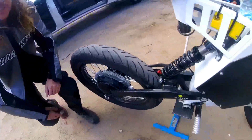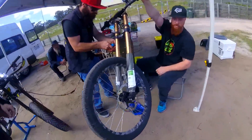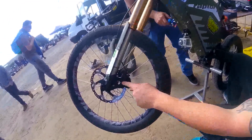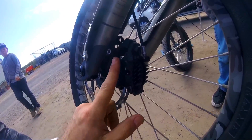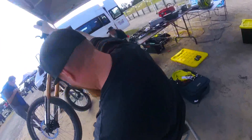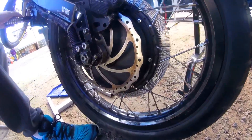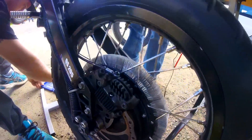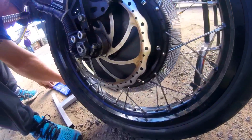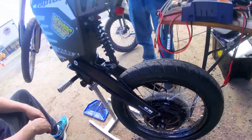They're even trying heat sinks on the brakes. Matt's got his brakes done and is getting exactly the same performance improvement — the brake pads are going everywhere with heat. Matt's also done his motor — this is the prototype version two with full coverage, and it's actually slightly more efficient because it's got another 20 percent of heat sink area. He's done it everywhere, even his brakes.